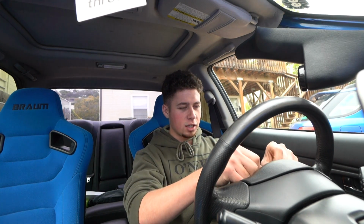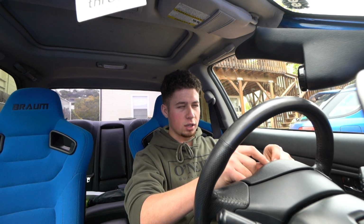And so I'm looking around, and then all of a sudden, I check my battery again, and it's at 12 volts. And I was like, I go from 12 to 6 back to 12, and then I go in my car, everything's working, the gauges are working, lights are working, like the car never died, and I was like, what the hell? Try to do it again, but every time I go into the run position, I get a one click or I get nothing. Like the car just gets sucked somewhere. Like I have a short to ground or something, right? Or my battery just popped and died and it was on its last leg.